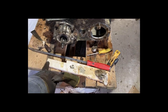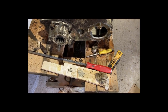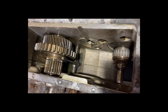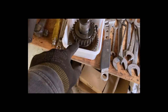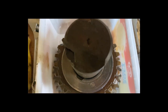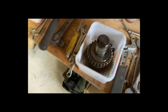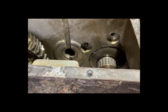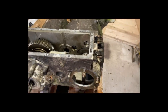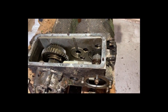That's why it's gone reasonably long. Found my long pry bar, which I picked up in a forest when I was chopping timber about five years ago. So that slides out, intermediate gear comes out. On the end of the shaft there's a couple of thrust washers to put back on, so we know there's no end play. There's three nuts which go on studs — two of the studs are pulled out, or unscrewed I should say, and one's left in. So now I should be able to pull the gearbox off. That's the top plate off.